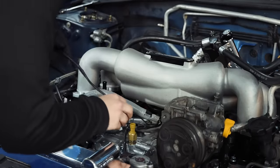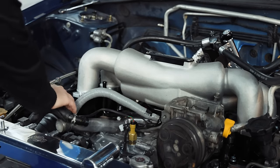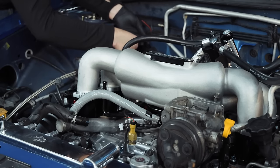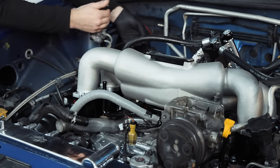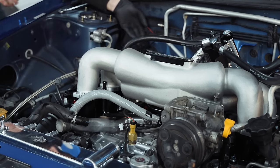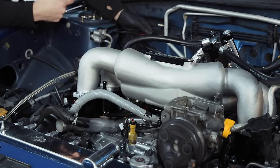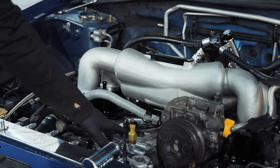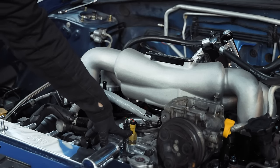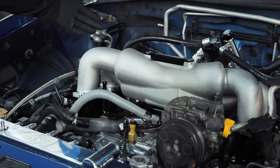I want to test the length on this before I keep heat-shrinking it — that's going to go right there. This actually works out pretty well because I have some slack on my end so I can push it down into the wheel well so it's not super taut all the time. I'll go ahead and wire up these two harnesses together, heat sleeve them, tuck it all in, and then our oil pressure sensor extension harness should be done. A lot of the time if you go off the front port and don't relocate the sensor off the block, you're going to have to extend the wiring.